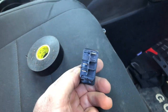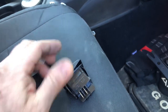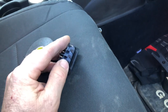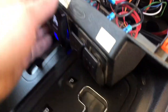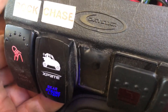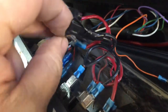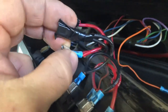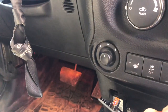I simply disconnected the three wires: there was a feed, there was a ground for the illuminated portion of the switch, and then there was what we call a switch leg or load that went to a relay underneath the hood. The third switch has been removed — that's where my new locker enable safety switch is going to go in this slot. The grounds have been disconnected, we have a feed. I want to get my three wires run up from this location underneath the dash, tie-wrap all the wires out of the way, and bring them over to the opening on the other side of the steering column.